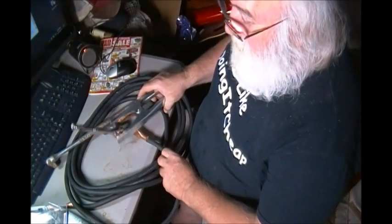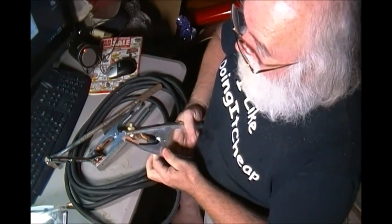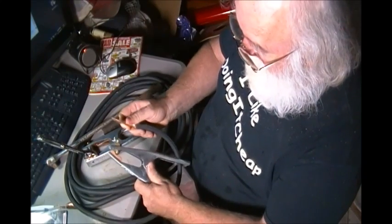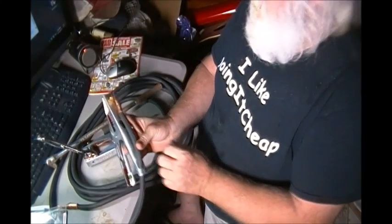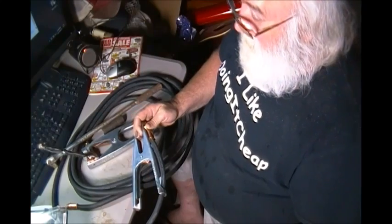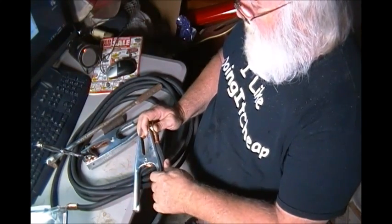And the way these clamps work here is you've got a brass fitting right here, and that appears to be copper. And we attach our cable to that right there. Now, notice how I'm going to run this wire right up through this handle, okay? And then I'll bolt it in place right there. I'll wrap some tape around it just to help identify, because I bought some red tape. So I'll put red tape around it to signify positive, and the other one I'll do with black tape.